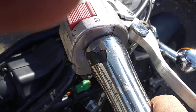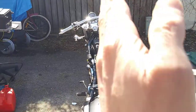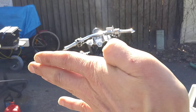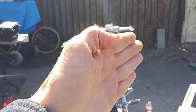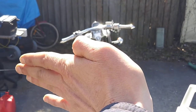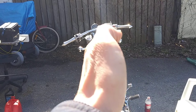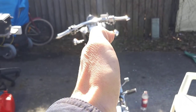To finalize and lock it down, sit on your bike, stand it up, and test it. Turn your handlebars all the way out to one side, open and close your throttle, then do the same with the other side. Everything should be smooth. If cables aren't set up properly, it'll open nice but close slow — or not close at all. If you're making a hard turn, your throttle might stay open and dump the bike or spin the rear tire out. So test lock-to-lock and adjust accordingly until everything is smooth through the full range of motion.